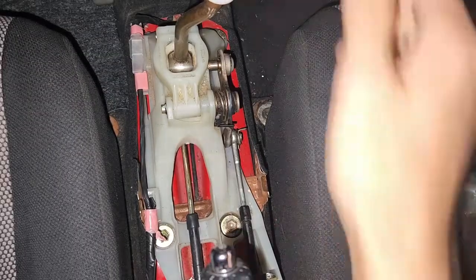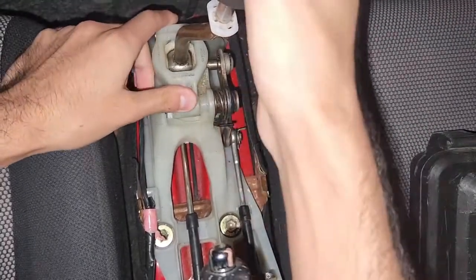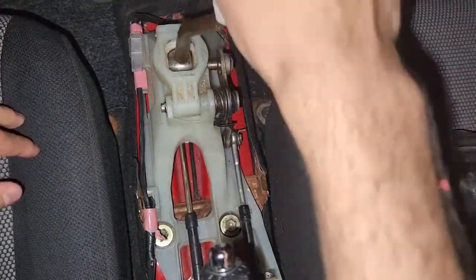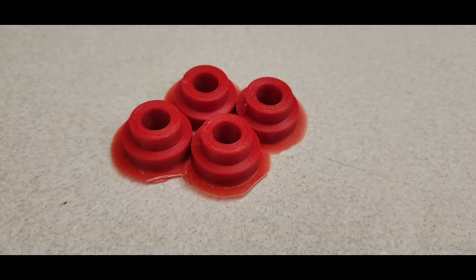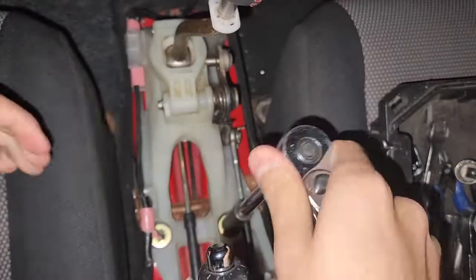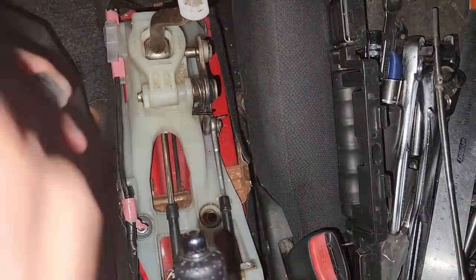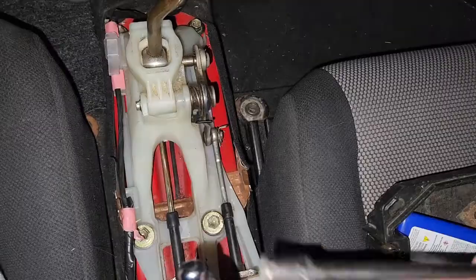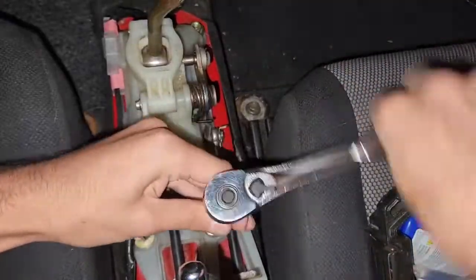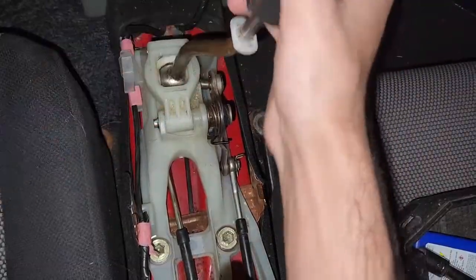The last thing to do is upgrade the bushings holding the shifter base in place. These are made of rubber but allow for a lot of play when force is applied. It doesn't really interfere with shifting that much, but it's noticeable when I shift hard, especially getting into reverse. To get rid of this I need to replace the rubber bushings with solid ones. There are some you can order online but I was able to find a model on Thingiverse — link in the description. One hour later and they are ready to install. Because these are solid I shouldn't use as much force so nothing breaks, but that also means the screw won't have a good bite on the threads, so I'm using thread locker and tightening by feel. Right away I noticed the shifter base is pretty much a part of the car now with how solid it is. What I've noticed from driving with this mod is that although it doesn't really improve shift feel in the middle gears, reverse is much easier to get into as you no longer have to fight the rubber bushings. As for vibrations, I can't really feel any on the shift knob, so it's worth the upgrade.